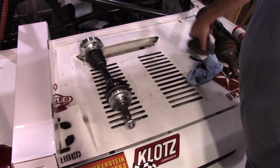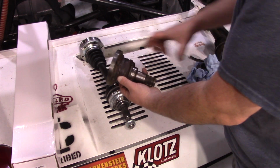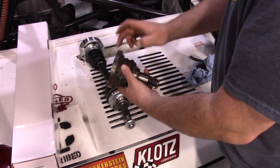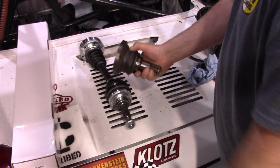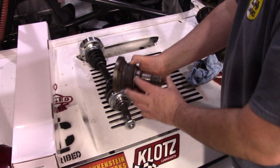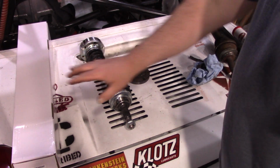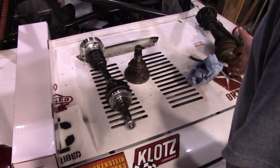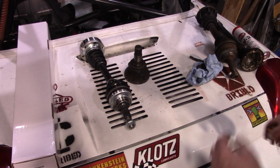The way that I did it back then was, essentially I just took the inner part of a tulip, this was back before these things were rare. I took one of these drive flanges, I cut them, I welded them together. Holds great. So this will connect into the EB60. From everything I can calculate, the axle is a 4 millimeter difference from what it should be. So that's great because there's more than 4 millimeters worth of travel in here. So it'll still be in the usable range.